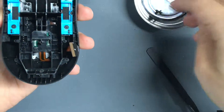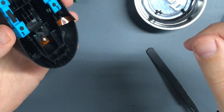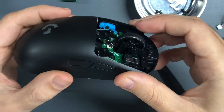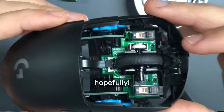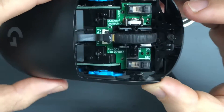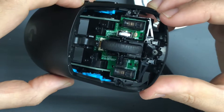Then the clicks and those four screws, the battery and that screw, the ribbon cable, battery cable, and then the seven screws on the bottom — it's the exact same thing in reverse. Shouldn't take too long. Sounds like a lot, but it's really straightforward. Just take your time and your G Pro Wireless is basically fixed forever. Hopefully this helps and gives you an idea of what it's like to install this.